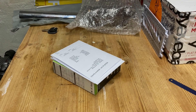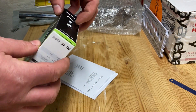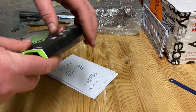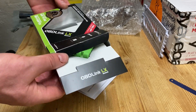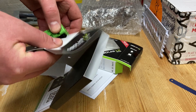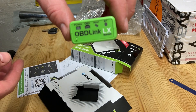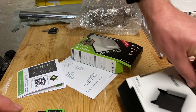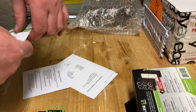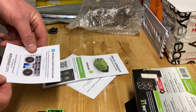We also need to make sure that we have access to the ECU. This requires a device for plugging onto the OBD link of the motorbike. I've bought a wireless Bluetooth-connected device which allows my Android device to actually connect to the ECU. It's a high-quality item, comes with instructions, and is really easy to use — you simply plug it in, turn on Bluetooth on your Android device, pair the two devices, and then you have access to the ECU.